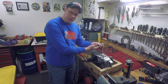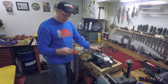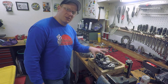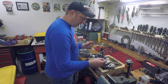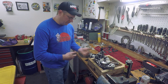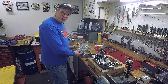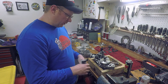Make sure you hold the connecting rod when you do this — you don't want to smash that into the side of the case. Just take a crescent wrench and slowly turn it, and it pulls the crank into that barrel. This case half is ready for joining. Dowel pins are in — I already test fit everything beforehand to check gaps. Now I'm going to apply Yamabond 4 gasket sealer, smooth it on, and then join the case halves.